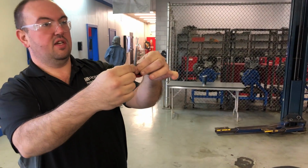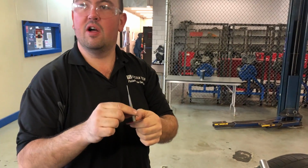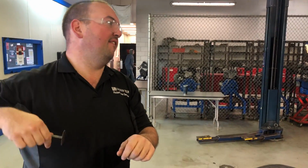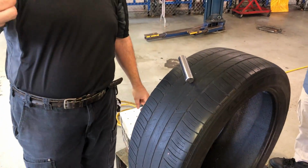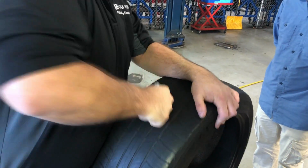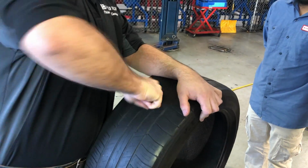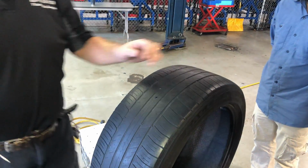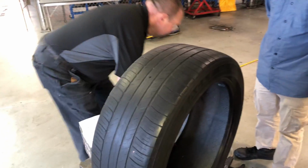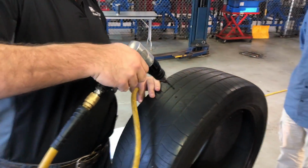if the hole is too small, I'm not saying a little bit, but if it's way too small, you're going to be fighting and fighting and fighting, and this is going to want to break apart on you. So we want the hole to be clean, so round, and we want it to be the right size. So you take the reamer and you work it a little bit. Okay? Now, you can also cheat. If you don't have time for a reamer, you can do a drill.